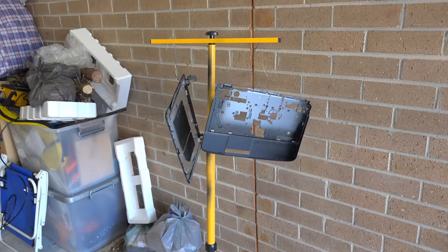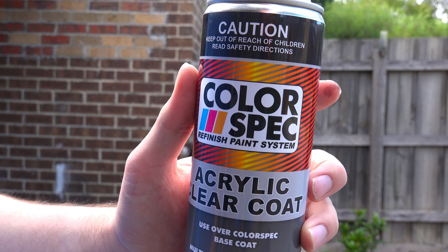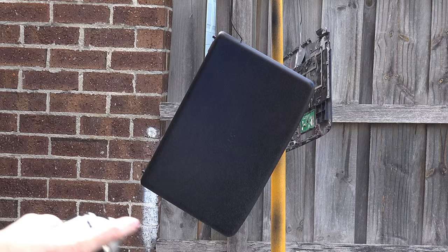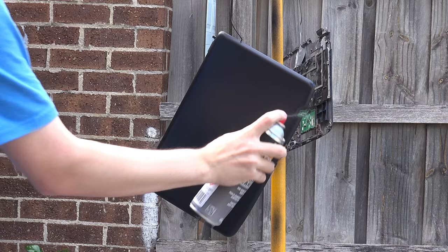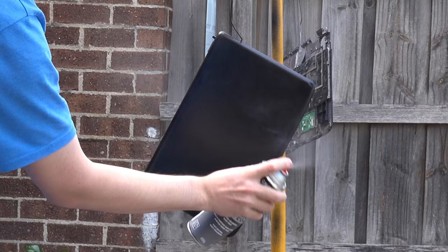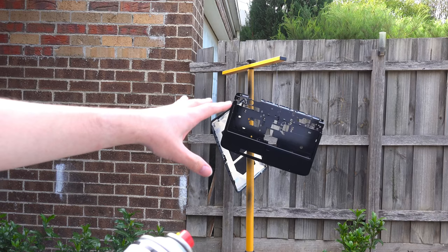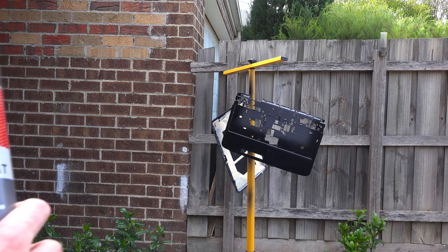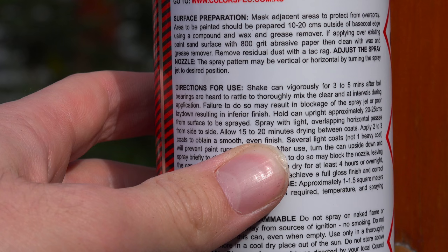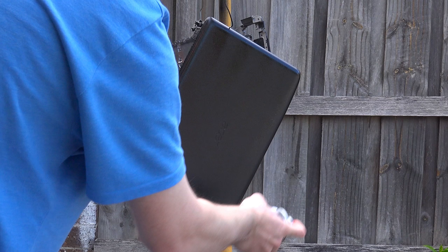After the final coat we should see a nice uniform satin black finish. Now it's time to move to the acrylic clear coat — we're using Colour Spec 1. Use the tack rag again, make sure it's well shaken, and start hitting our coats of paint. You can go a little heavier with this as small mistakes can be corrected. One thing to note: if you're using acrylic paints, make sure it is legal in your country to spray acrylic paints outside, as in some countries it is illegal. Allow 15-20 minutes to dry between coats and apply 3-4 coats. Once all painting is done, hold the cans upside down and spray out any remaining paint in the tube.